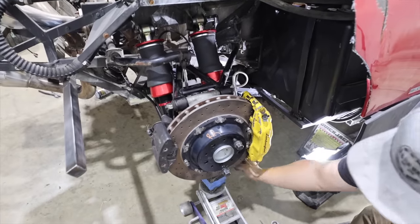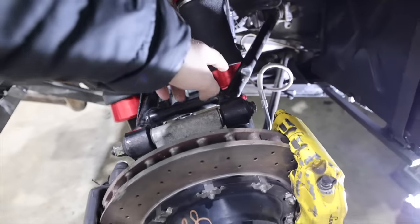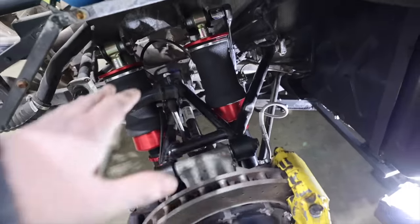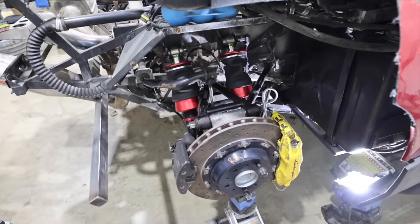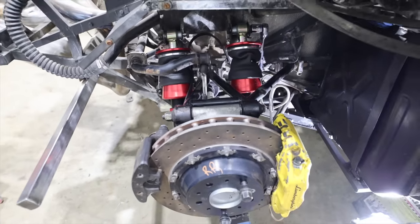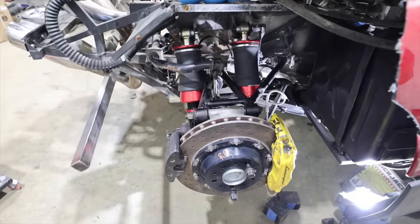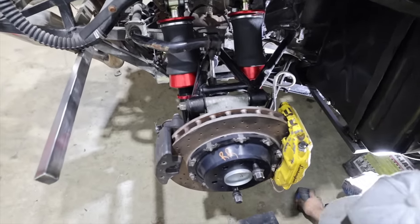We tested the back first since it's the tightest fit and most complicated. With our control arms, we had pre-measured — they have all the diameters of different styles listed on their website — and we confirmed they would fit. It's obviously very close but nothing is touching. Oscar pumps it up and you can see it gaining more and more space as it compresses — this would emulate making the car go lower. It's working very nicely; you can articulate the suspension to check everything before you commit.